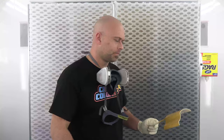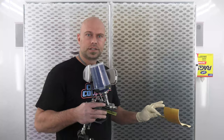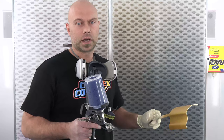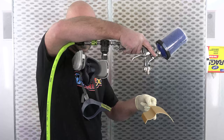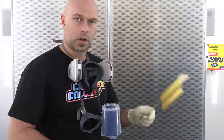Welcome back — paints in the cup and the gun. It's an LPH 400, spraying right at recommended pressure which is 16 psi. Same thing — nice even distance, 75% overlap, really really tight overlap. It's probably overkill for this piece but that's fine. The really key part is being consistent with your gun-to-panel distance. You don't want to angle the gun — you want a nice even fan hitting parallel to every angle of your part. So we're going to do coat number one. We'll go through the gold, silver, and charcoal — probably four coats total.